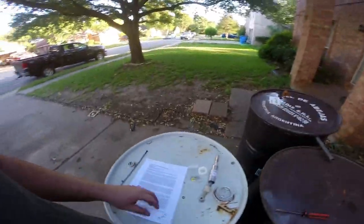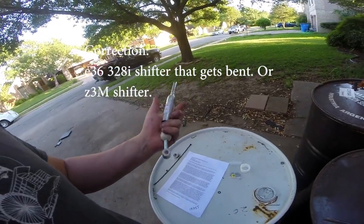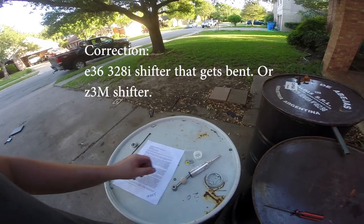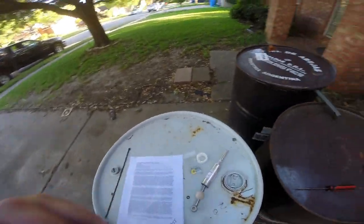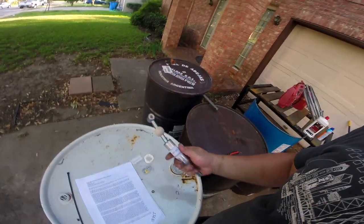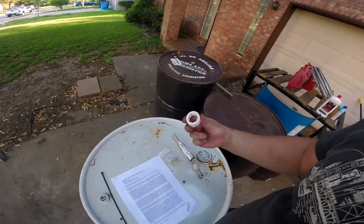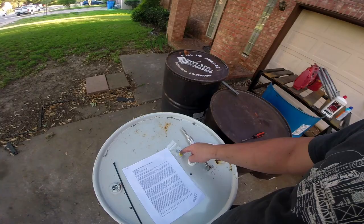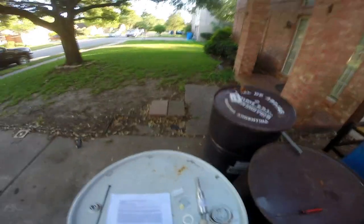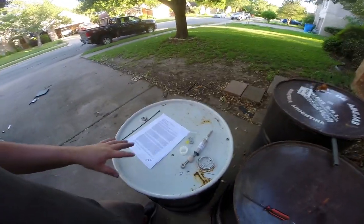The final thing on our performance agenda is this — basically an E28 Euro shifter that's been modified and further bent for 40% shift reduction. This kit comes from Understeer, it's a little pricey at $155. But this is one of the few things I splurged on because this is the right part done right. It comes with a brand new shift cup, brand new C-clips, and brand new yellow spacer thingies. For this you have to have the car in the air, but it makes a huge difference in everyday drivability.